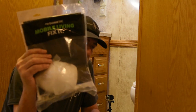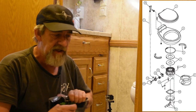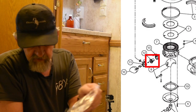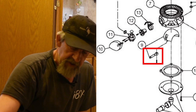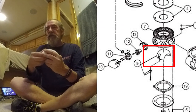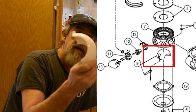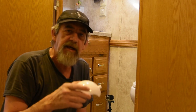I did some more research and found out I got the wrong kit. This is a ball and shaft kit from Dometic, part number 385318162. What comes in this kit is this return spring, some new screws, and this brass stem. What I got wrong is this piece right here — the one that's in there is just a little bit narrower and it just doesn't work, so I'm going to have to get back in there and change it again.